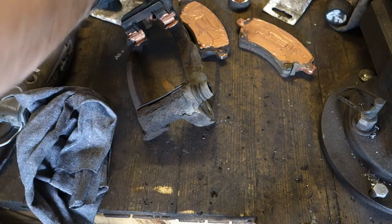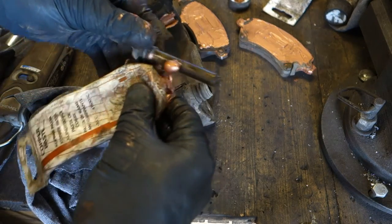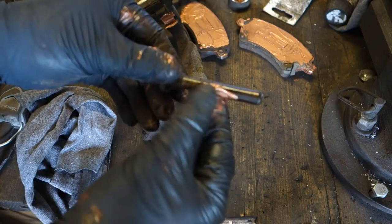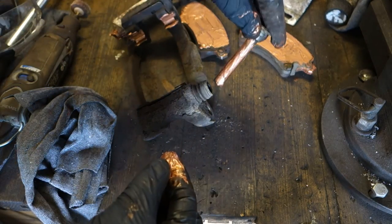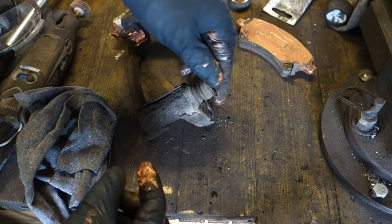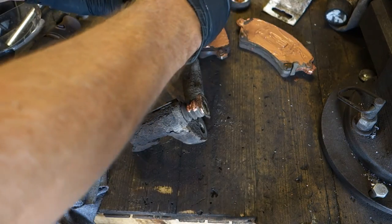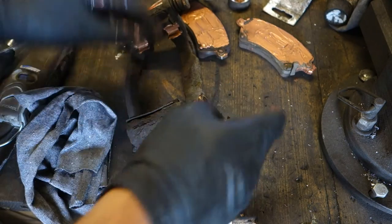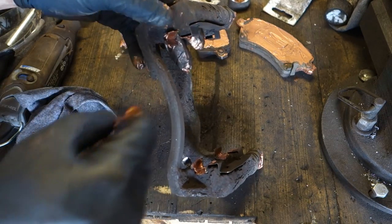And then I like to show also how to make lubrication in that steering bolt. And in that area we can also insert this copper paste in that way, a little bit in there, and then lubricate all areas. And it is easy to install back. I only press that in totally, and now it's free. And now there is nice lubrication. Okay, good. And then I test how this brake pads holder works.